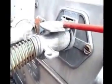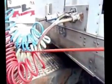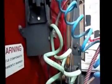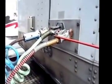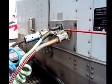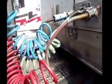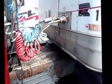Okay. Then I'm going to check my air hoses. Make sure none of them are ripped or torn, properly attached to the cab and the trailer. Okay. Now make sure the glad hands and the seals are not ripped or torn, and they're not leaking, and the air hoses are not leaking. Okay. Check the bulkhead. Make sure it's not bulged out to indicate a shifted load.